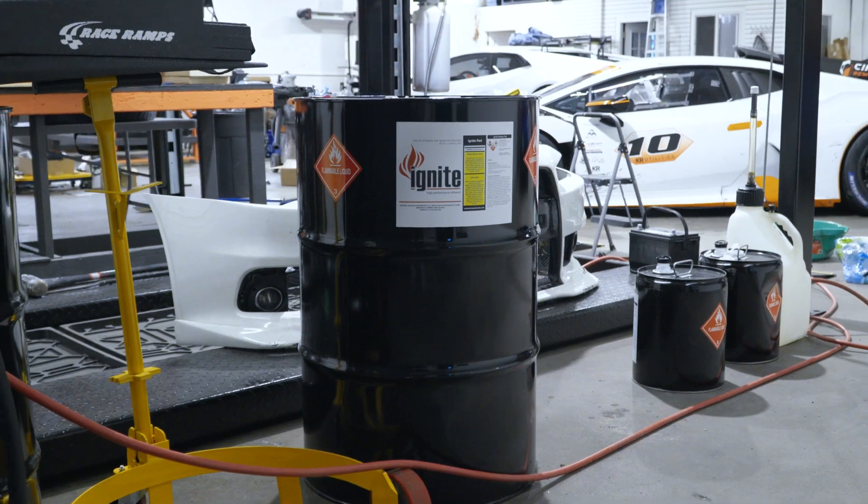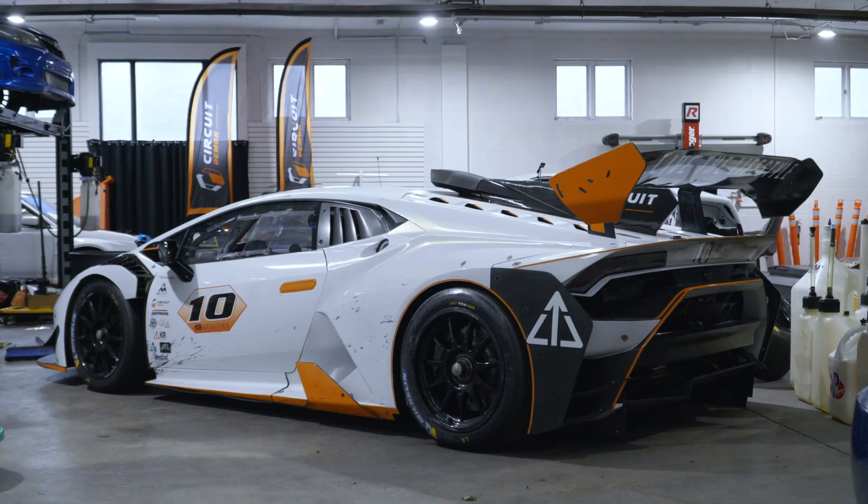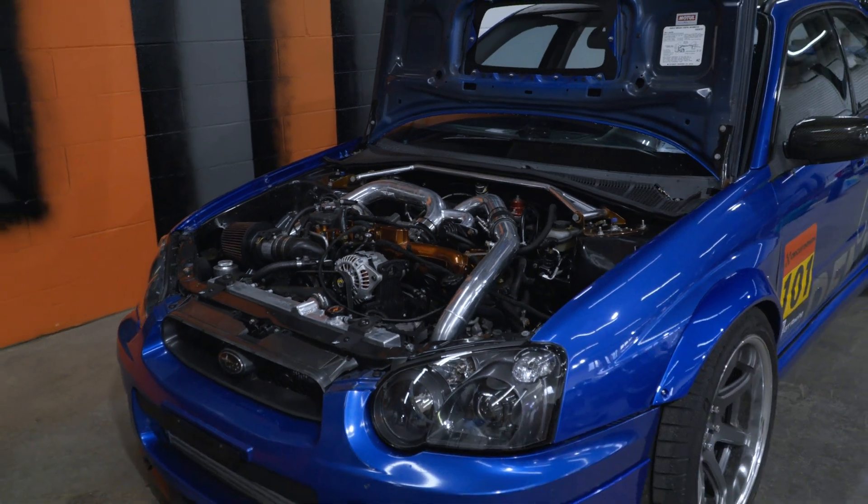There are some things you need to know about ethanol specifically for your VB WRX. Shelf life: ethanol is hygroscopic, meaning it absorbs water even out of the air. If you're going to let your car sit for a few weeks — say you're going out of town — it's advised to try to switch the fuel about every two weeks. If you're storing the car over the winter, as we do up here in New York, I would strongly advise getting the ethanol out of the tank and putting 93 in. Not only is water bad in your tank and engine, it can also cause your injectors to rust or clog, which we have actually seen here at the shop.